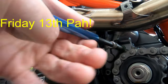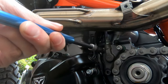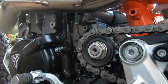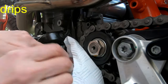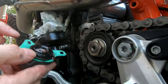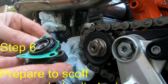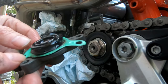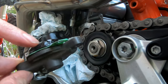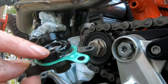Two 8mm bolts — one, two — right-hand one. It's quite tight in there. That's definitely the engine oil, it's not set. Look at that — it's only done 500 miles and it's gone away. So I'm glad I took that off. That's amazing. I thought it was just people being alarmist that these fail, but look. That's really bad.